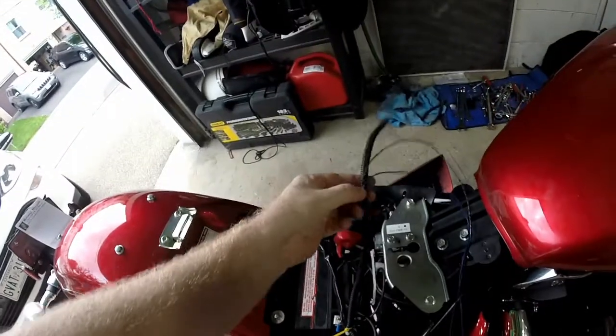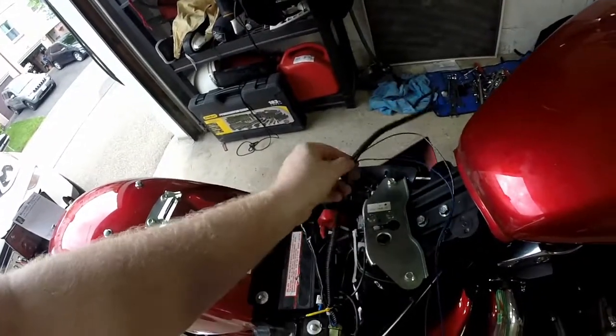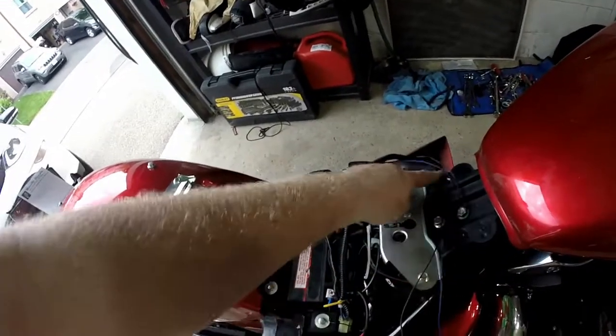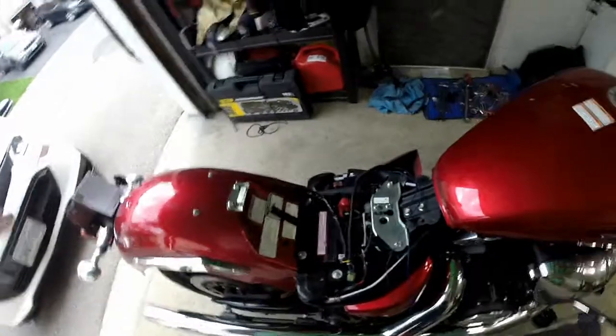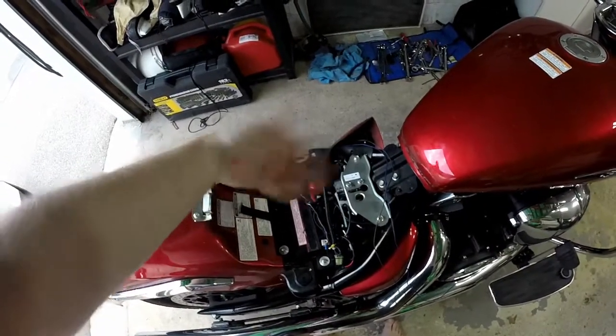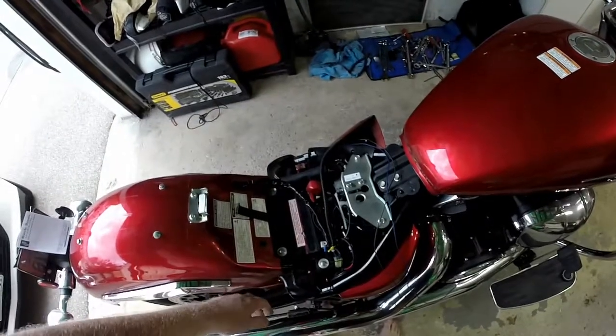So I'm just wrapping my wires in some black corrugated loom. The reason for that is that if these wires do start contacting the frame I may end up shorting the light and therefore boiling the thing under there that I don't want to boil. I don't know what it's connected to.